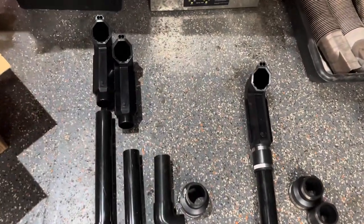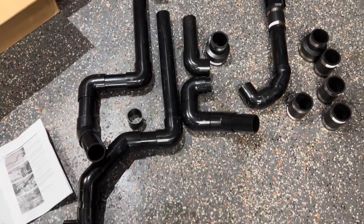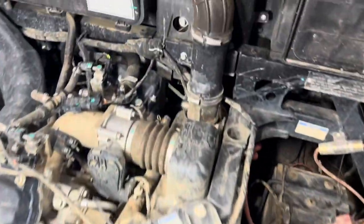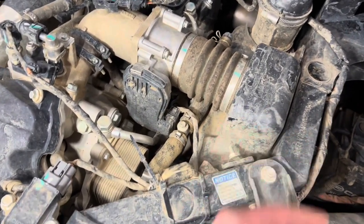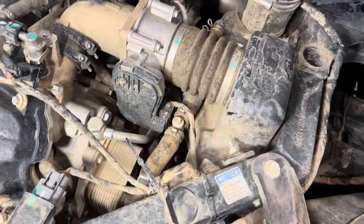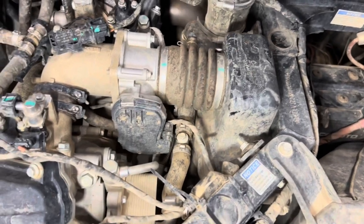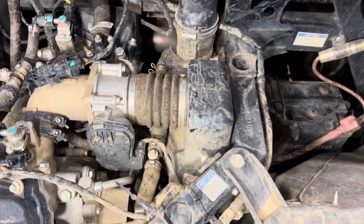Here's all your pieces and parts: three risers, CVT outlet, inlet, and obviously the airbox. The only thing I don't like right off the bat is that the riser kit doesn't seem like it's going to delete this airbox. I think it's going to connect up here, and I've seen my buddy's airbox suck water in through a crack in one of the seams — that's one thing I really don't like. Maybe we'll have to figure out how to get that bypassed or make a new one.